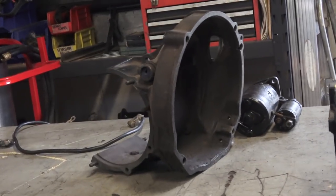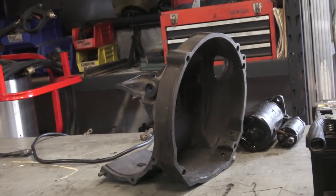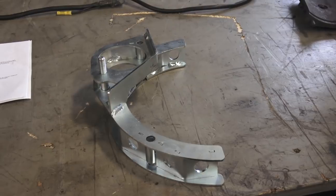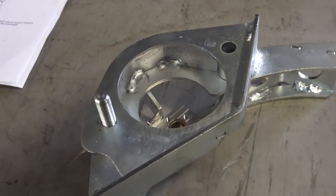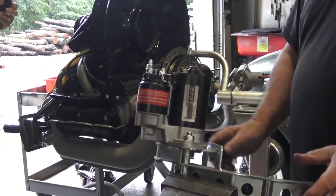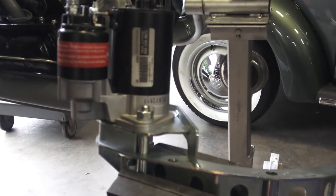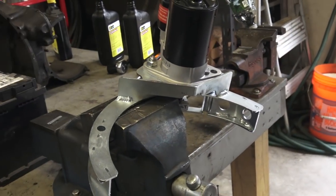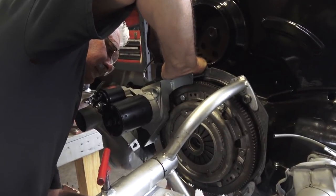No more are we going to be using those old bell housings or sawed-off bell housings from old VW trannies that we used to use to start on the bench. Instead, we're going to use this ring — it's like a half-ring that you attach to the back of your motor while it's on the engine stand. You insert your starter here, and you can get a 12-volt or 6-volt ring. I have links in the description below. We attached our starter — a brand new 12-volt starter from AutoZone, which is pretty compact — with the ring, and put it up to the back of the motor.